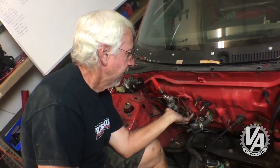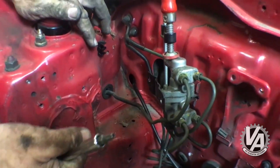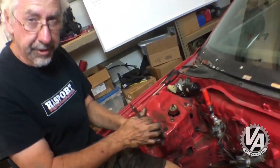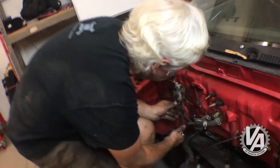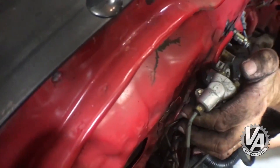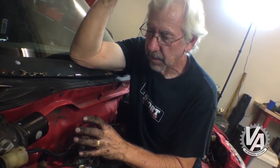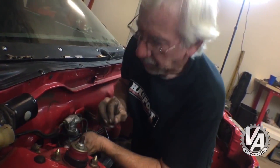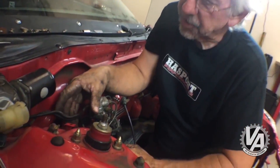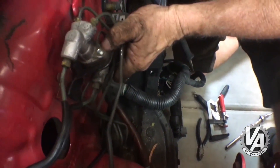You see a lot of people that just kind of have it zip-tied up to the edge, and that doesn't look good. These use safety Torx bits — it's actually designed not to come apart; they've come in here and scored the thread to kind of lock it in there, so when you take it apart it's going to straighten and damage it out a little bit. We've got our bracket screwed on the other way and can now get it up against the firewall. We'll probably drill a couple holes since the AC evaporator is gone, and that way we can bolt this firmly up against the firewall. There are no kinks in the lines — we just straightened out a few and put a little extra bend in a straight section. Now we'll be able to attach this up against the wall and get it out of the way.